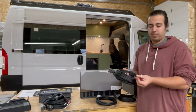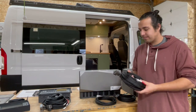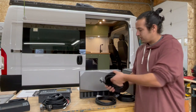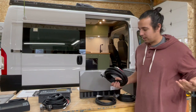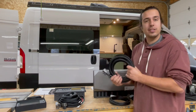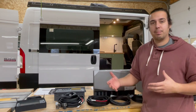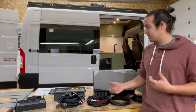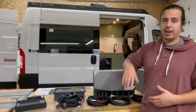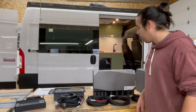The alternator charging plug comes pre-wired with terminals that go to your van battery or alternator, however you're going to hook into your drive system. It plugs right into the unit with basically no wiring. This is six gauge wire and for the amount of length here, this is about a hundred dollars worth of wire. Each one of these wire connections — when you add up a system you build yourself — you're probably not far behind this in cost, and if you're doing a Victron system you're way above it.